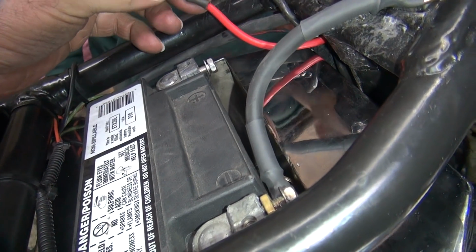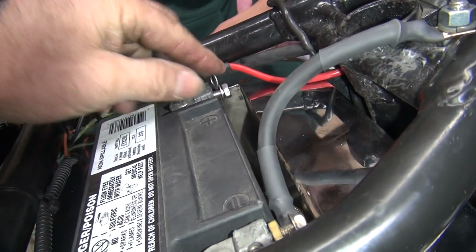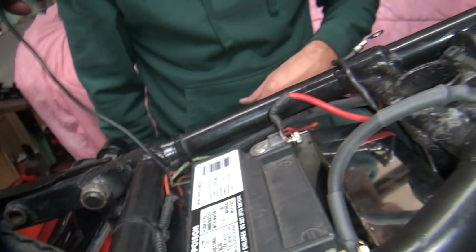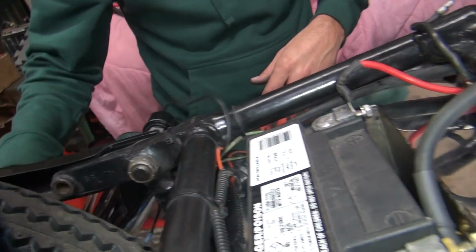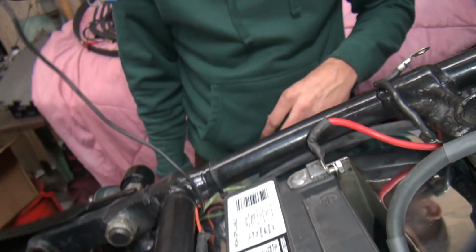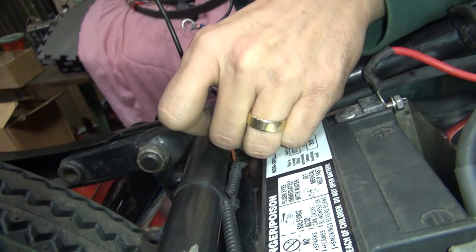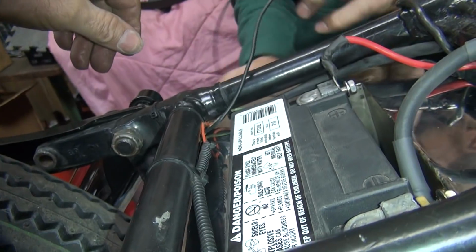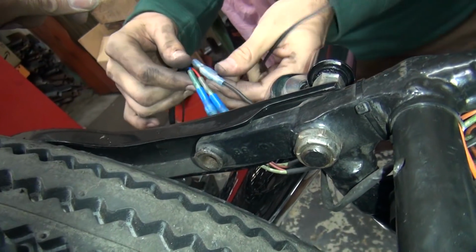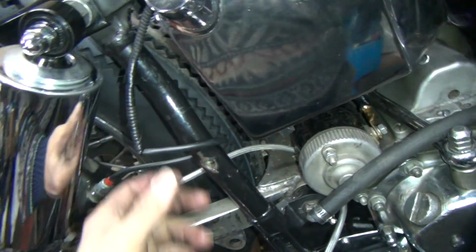And what's this piece of crap for? I assume that's an ignition switch? Yep. So that has to go over here? Yep. Okay. So that's got room to put that back where it belongs. What is this over here? Tail light. Okay, we don't care about that. I don't know why you got such a big terminal on that thing. Gee, that's a 5/16 full. That's huge. Yeah, this whole tail light wiring is. Oh, how many splices in 3 inches do you have? That could probably be upgraded.